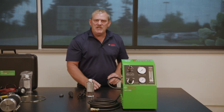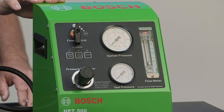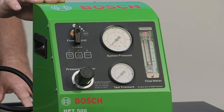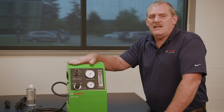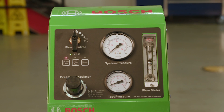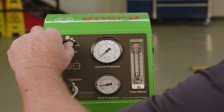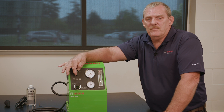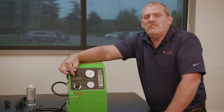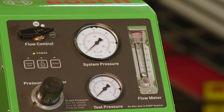Let's take a quick look at the machine face, back and front, and the controls of the HPT500. First thing we see is a variable control valve. This releases pressurized vapor into the system. Close the flow control to lock out the system for the pressure decay test. Two is the power indicator green light, which indicates proper connection to the electrical power.